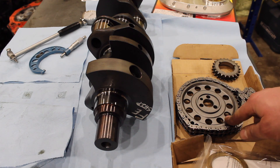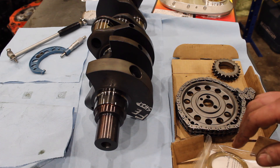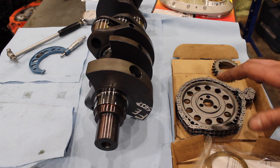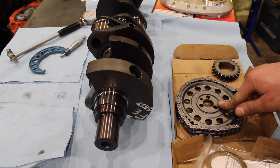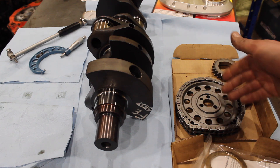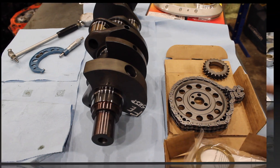If you follow me on Instagram you'll see I went with a Howard's Boost camshaft, and I think it's going to be a better combination. I went a little aggressive on the first cam and it was hard to tune with EFI, so I think this is going to be a better setup. Just remember, as far as I could find, there is no step-nose gear set with a big block snout for a small block Chevy — so just be aware of that.